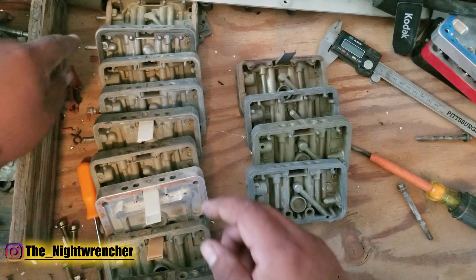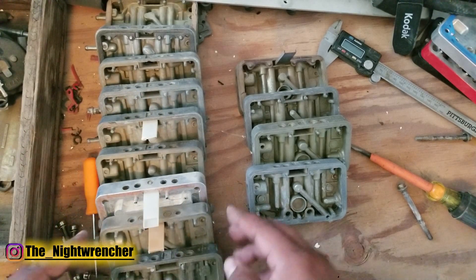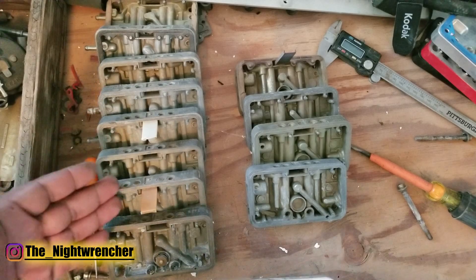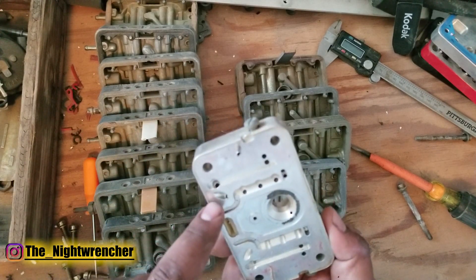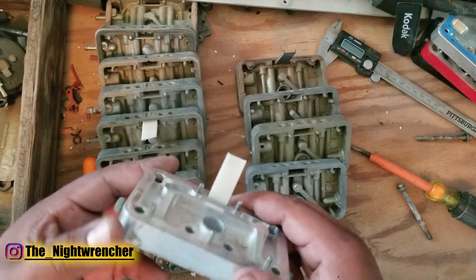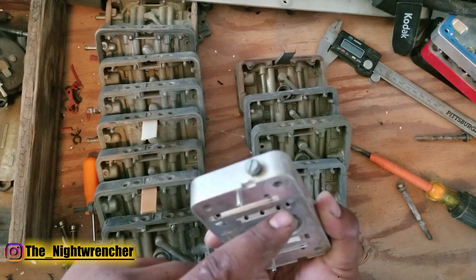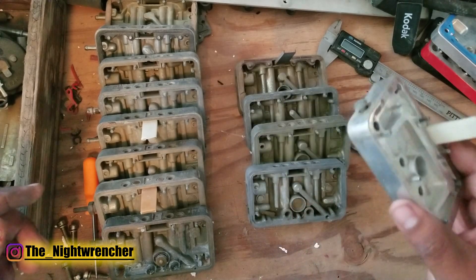There's a larger size and then there's a smaller modern size. The last difference is whether or not it came factory with a whistle tube. There's one oddball one — this is the one for Barry Grant, which came factory billet aluminum. Aside from that they're no different from the others except these come with three emulsion holes and these only come with two, but that's not necessarily too important unless you're going into a lot of fuel flow. When I run the aftermarket metering blocks with five holes, I actually have the middle, top, and bottom blocked off and the second and fourth drilled out just like a standard Holley one. With three holes they actually made them smaller — about 23 thousandths maybe even 20 thousandths per hole — versus the standard Holley ones at around 28 or 25 thousandths depending on the model. We're going to be excluding the Barry Grant one since we don't actually need it.